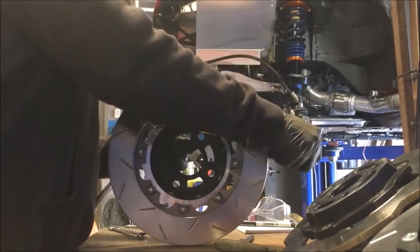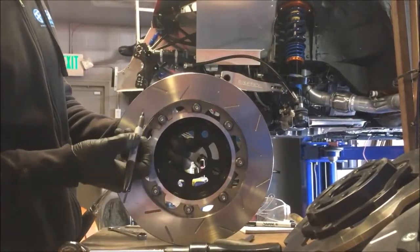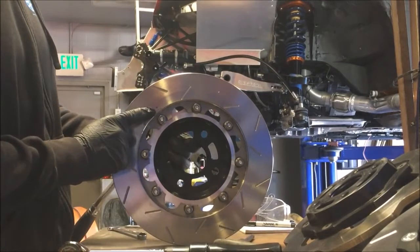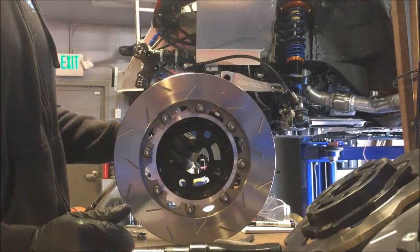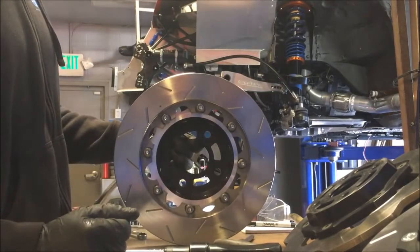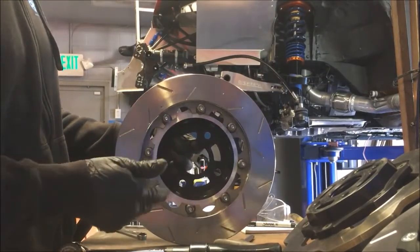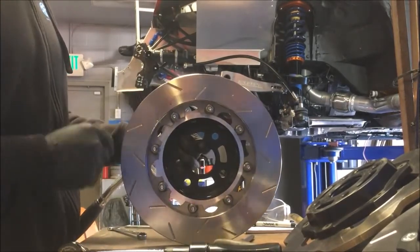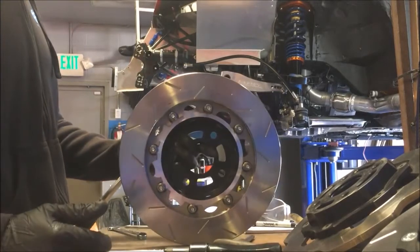And there's the click. The other trick we like to do is as soon as you set one nut to the correct torque spec, put a little dot. I like to put the dot on the friction surface so that after you use the rotors, you've basically scrubbed the dots off and they're not there anymore. If you reuse the rings and disassemble them halfway through their life, when you re-torque and reassemble the hats, you don't already have old dots next to the nuts that you're trying to remember. So put them on the friction surface — as soon as you've used them, those are gone and they're fresh for new dots if you reassemble them down the road.